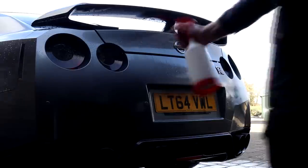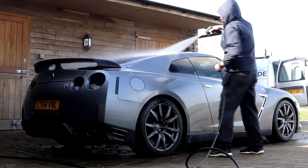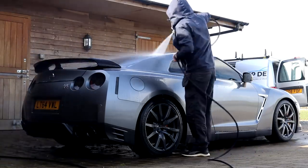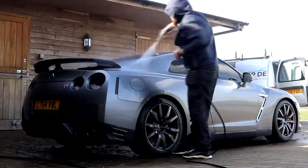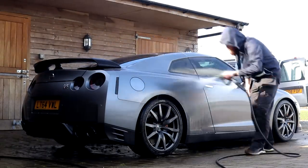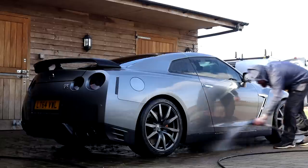After the pre-wash had been given a decent amount of time to dwell, the bodywork was rinsed down incredibly thoroughly. At this point, I will spend a bit of extra time ensuring that all areas are thoroughly rinsed, because before we move to the contact hand wash, we'll want the vehicle as clean as we can physically get it. Not so important on your daily runaround or family wagon or even a heavily neglected vehicle that already has an abundance of paintwork defects and imperfections. If there was ever a time to spend a little longer to do the vehicle justice, then today would certainly be one of those days.